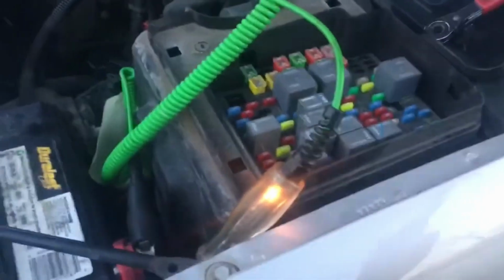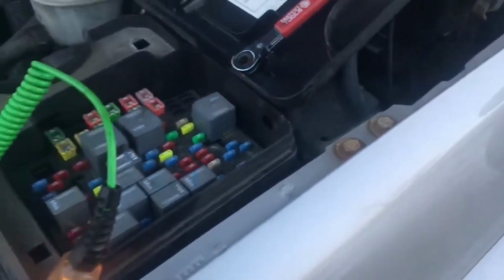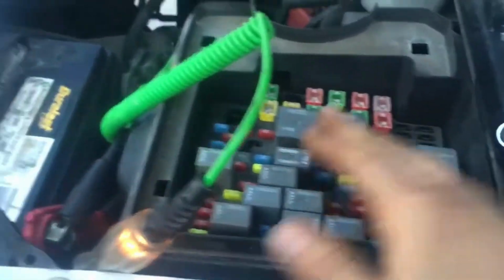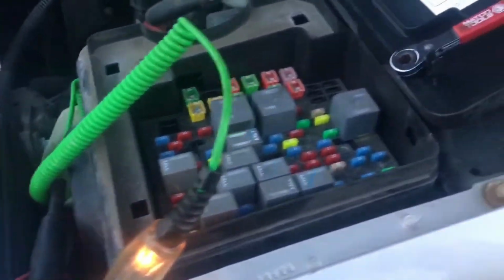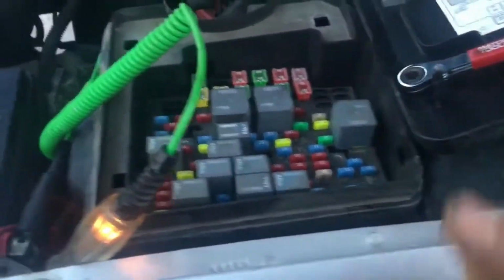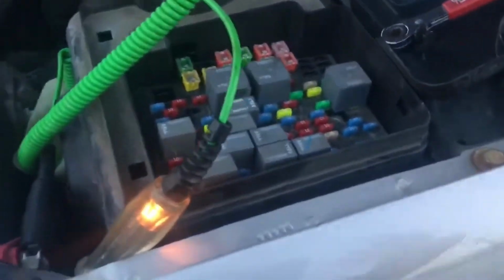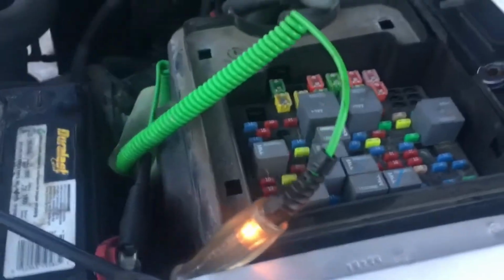Now, it's good to have two people doing this, because you're going to start pulling the fuses that are on the inside of the car first. The reason is that most of the time your draws are probably from the inside of a car. They're not generally going to be in your master stuff. Say your throttle positioning switch isn't going to go bad and create a draw. It's possible, but highly unlikely. So you're going to pull each individual fuse, and take a picture before you do that so you can replace all the fuses easily and put them in the accurate spots.